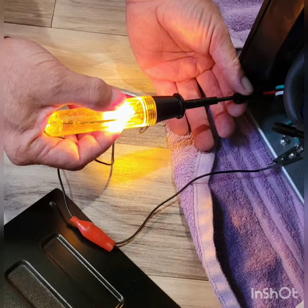Now, put the 20-amp fuse back in the converter box very carefully. Get a test light and make sure you have power at the refrigerator.